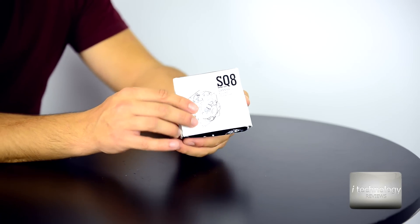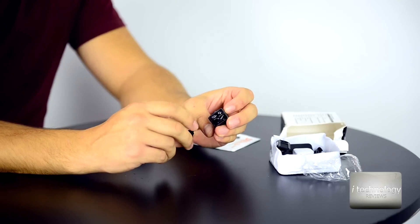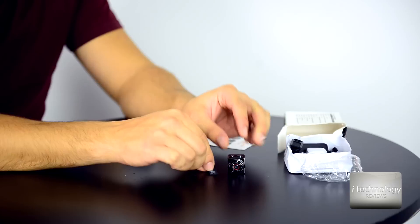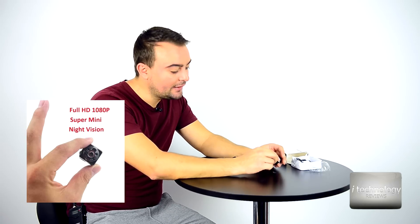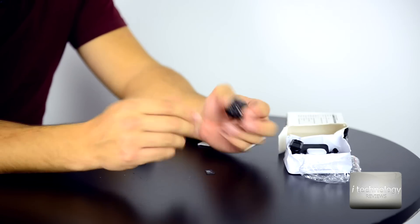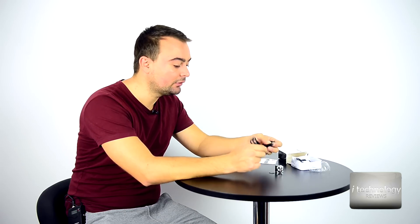It's fitted with IR lights — infrared lights. It's 1080p and 720p and you can choose the format at 30 frames for Full HD. I downloaded both formats and the properties at 1080p say it has 30 frames, but we will test this on other websites and you will see that in Full HD it actually has 12 or 15 frames per second. The image proportion is 16 by 9, not 4:3 — you can't make a 4:3 aspect ratio at Full HD or HD because at 1920 by 1080 it's not possible.